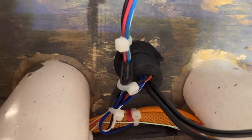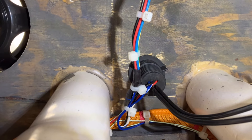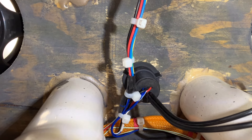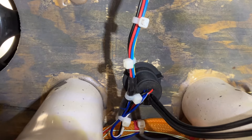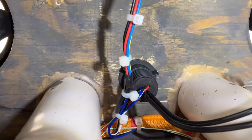I figured out I could run the red wire to constant power and then use the remote input to trigger it on — the remote in for the JL Audio Bluetooth controller. That way when you turn the switch on, it just automatically turns this on instead of having to push both power buttons.